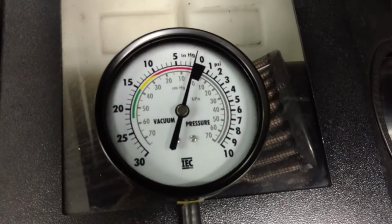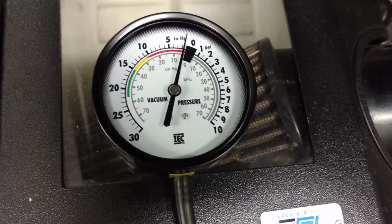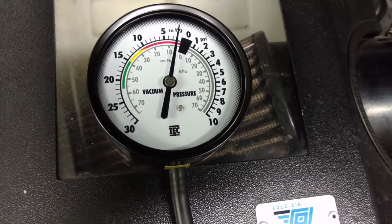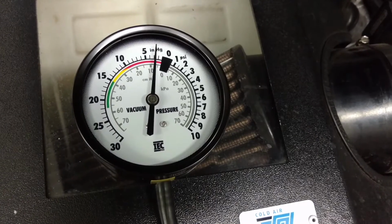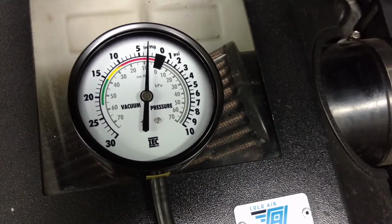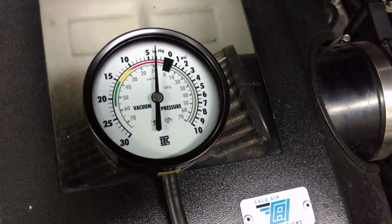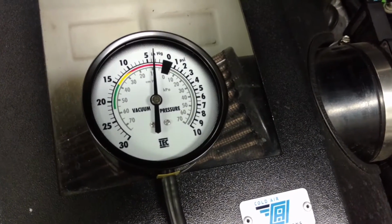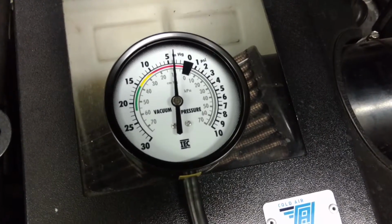All right, so you hear it's quiet here, right? So as you'll notice, with the number 10 fitting, we're not getting jack in pressure, which is exactly what I really wanted to show in the first video. Unfortunately, that stock barb just left a little bit to be desired when you're throwing a whole air compressor at it. So you see we're at a crankcase pressure, building vacuum.